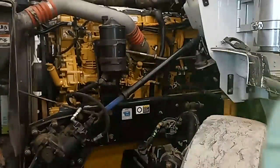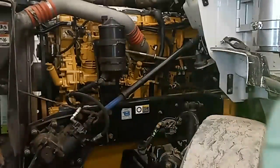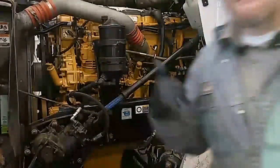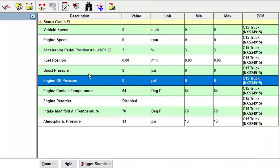It is nice to have oil pressure right away. This engine had sat for two weeks while I was rebuilding it — it has a new head, new injectors, new bearings, everything. For it to start like it just got shut off five minutes before is amazing, but that's how you can do it if you prime all the systems. Here's a screenshot I recorded of the cranking — what we're mostly going to watch is oil pressure, to see how quickly it builds.